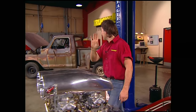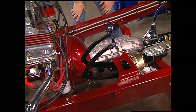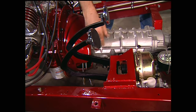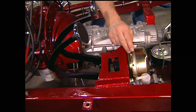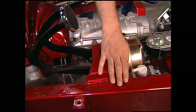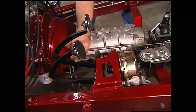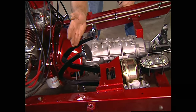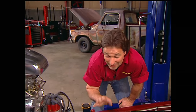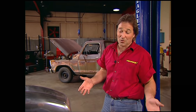There is one other option: completely forget the junkyard and convert it to a hydraulic clutch. This is usually for a really tight application — it's slick and does away with all the linkage, but there's a lot of fabrication involved. You've got to mount your pedals to the frame rail, which means the frame rail will have to be boxed. You need a master cylinder for your clutch, and notice the pedals come up through the floor as opposed to hanging down from the dash, which means you'll have to cut your floor. Dan, I don't recommend this for your truck because you've got too many good options in the junkyard. I hope this answers some of your questions.